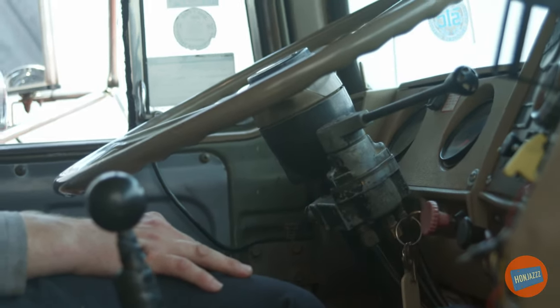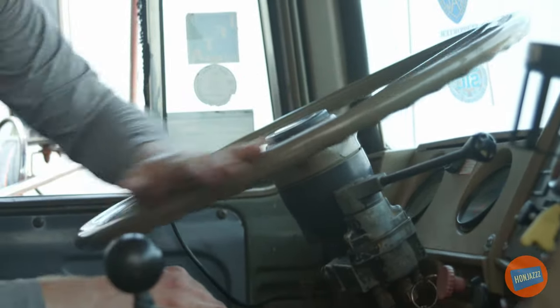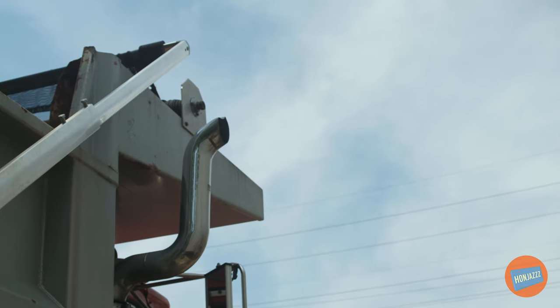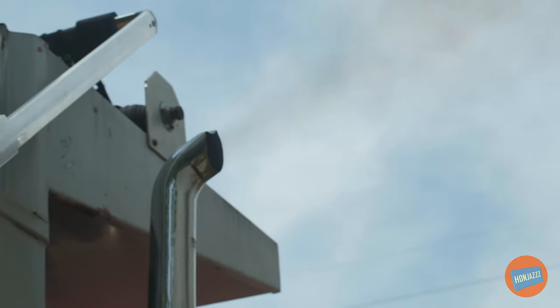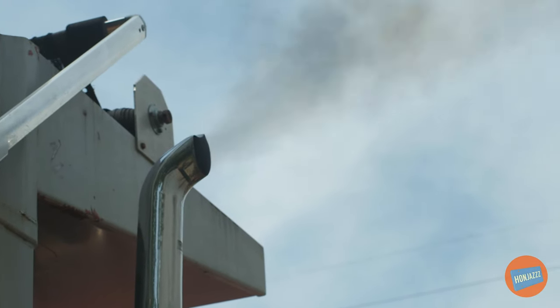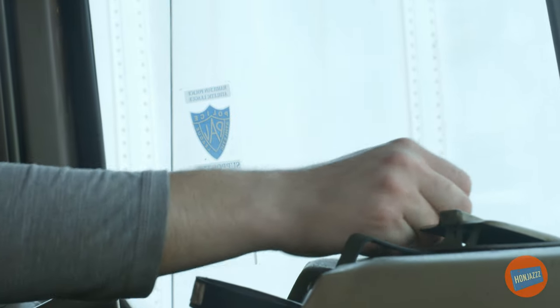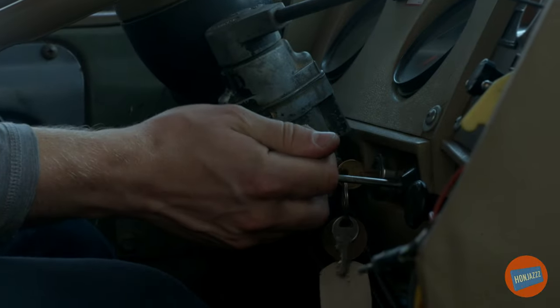Turn signals left and right — beautiful. Power steering. The first thing that's cool about an R-model Mack is this is the in-cab vent — if the driver's getting very hot you can open that up to relieve some air. Power divider locking in and out, all-wheel set — that's if you're getting stuck. It's got an air seat, so you can raise and lower it. To shut the engine, turning the key does nothing — the key is off, so in order to shut the engine you turn the key off and pull the fuel. Thanks for watching guys, subscribe.